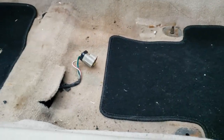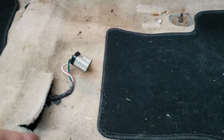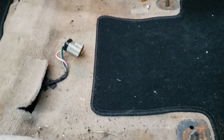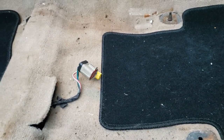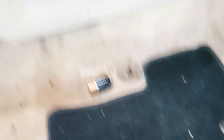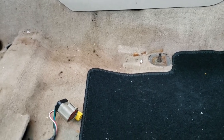Underneath the seat was nasty. I bought this Mustang to rebuild — the inside is real good, but you can see where people spill drinks and stuff. You've got four bolts to take out: the front ones are 13mm and the rears are 15mm. On the power seats you've got two plugs — very simple to unplug and pull the seat out. What I found binding my seat was a D-cell battery sitting right there in the tracks. It's been there so long it left an indentation in the carpet, and you couldn't see it when you looked underneath.